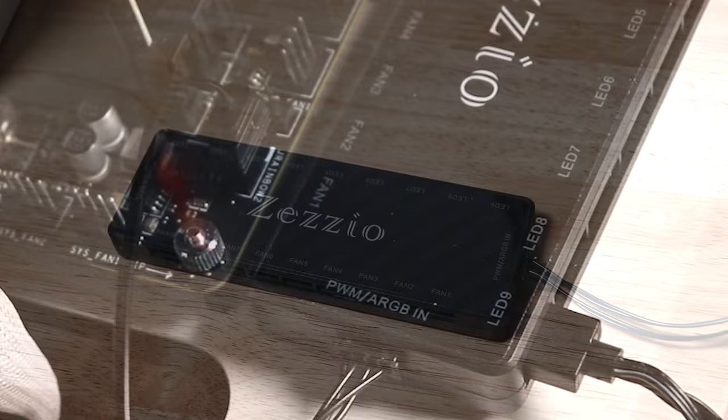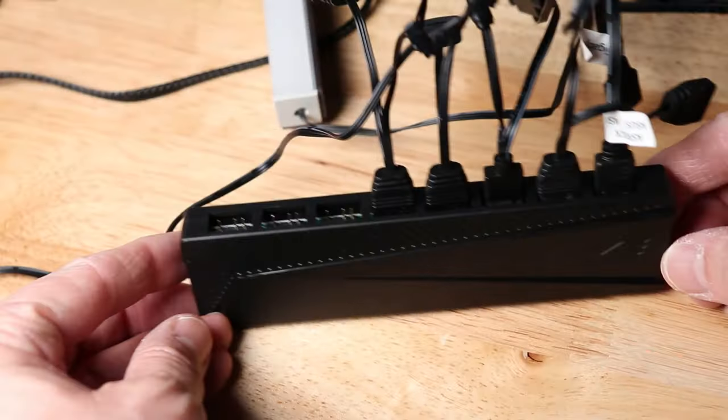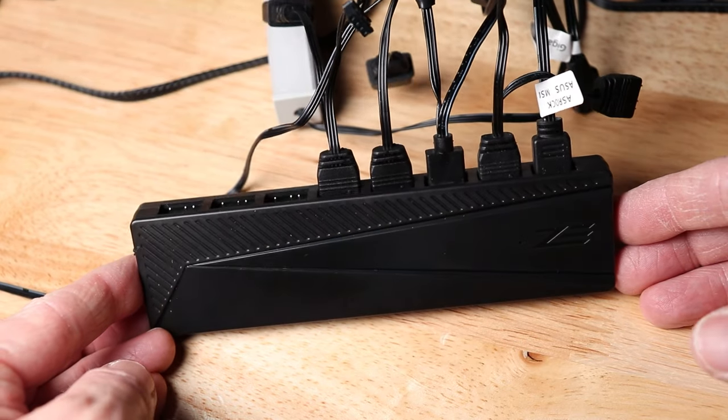I've taken each of the two J-Rainbow ports and connected an RGB hub to each of them. The J-Rainbow port is just a standard 3-pin ARGB port that kicks out one signal — you can plug a device, RGB strip, or fan into it and it works fine up to a certain LED and power limit, but there's no ability to hook up multiple devices to it. These hubs are fairly inexpensive SATA-powered repeaters that take the signal from the motherboard and repeat it out to all eight connected devices. The advantage is you can send a different lighting sequence to each hub, creating zones with different effects.